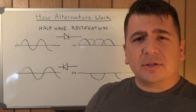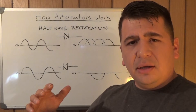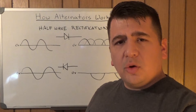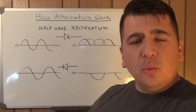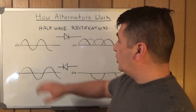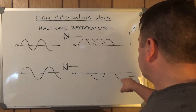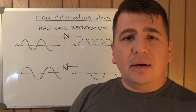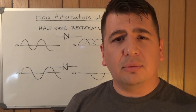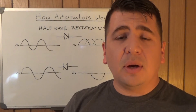I hope you understand the process we walked through: how we take the two areas of electromagnetism into consideration and use the low current to create a magnet that the engine will turn inside of the coils on the stator to generate AC voltage, which is then cut in half both ways — to the high side and low side — giving you your positive voltage and your ground. I did my best to simplify this so that you can understand it for those who just want a good basic understanding of how the alternator works. Stay tuned for our next video, and I hope to see you then.